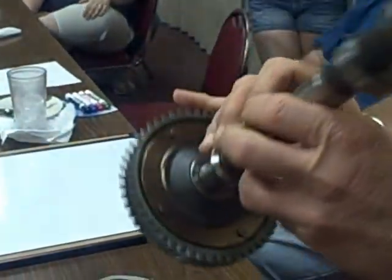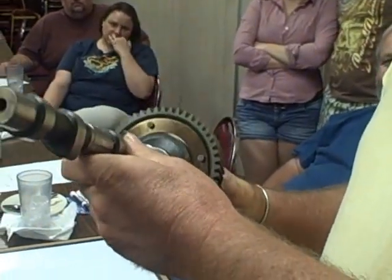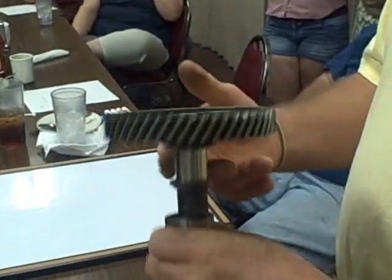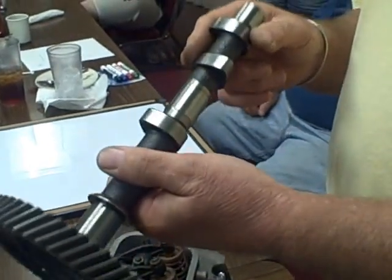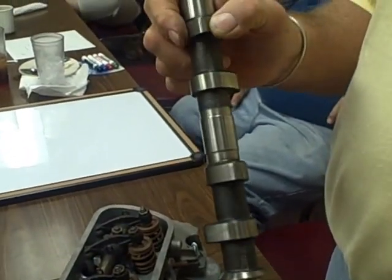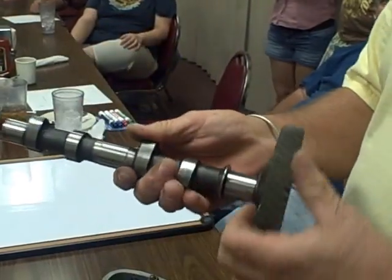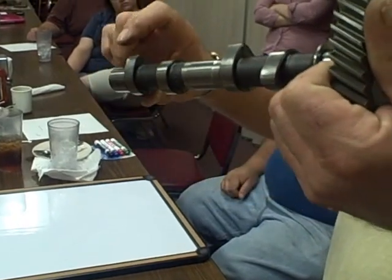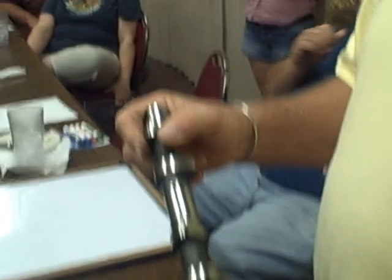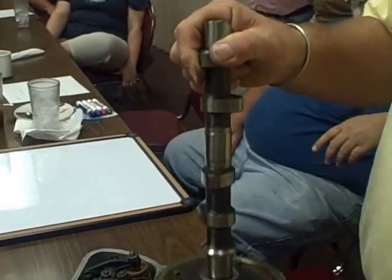And your cam — if you look at cams, the lobes get worn on the lobe part, and that ruins your valves and all that stuff. I got three of these cams which are in pretty good shape. This is a four-rivet cam. Duration and lift: it's just how long the valve stays open and how high it raises. That's done by the length of the lobe and the height of the peak at the top. I've got one cam at the house that's got a wide lobe and it's really high — it gives you a good sound. It's more important to have duration. Duration is how long the valve will be in an open position.